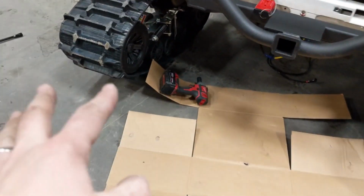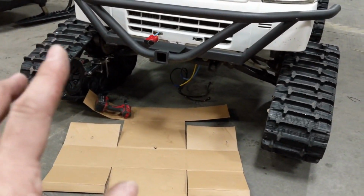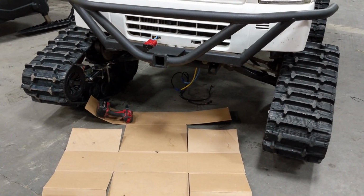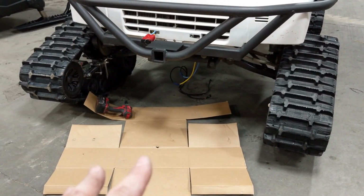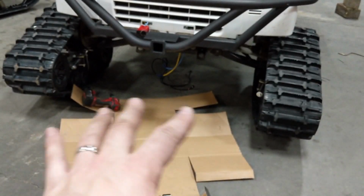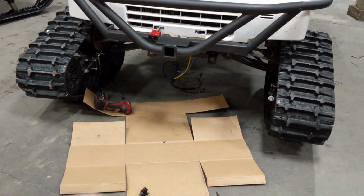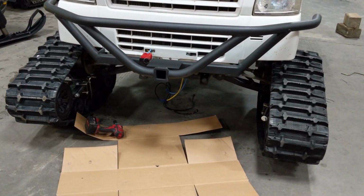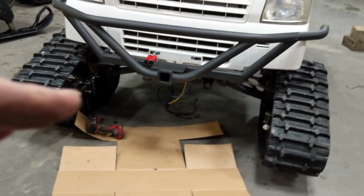And before you do your wheel alignment, once you drop this truck off the jacks, don't do your wheel alignment on the jacks, for one. You'll get it wrong for sure. And don't do it once you just drop the truck down off the jacks. I always like to drop the truck down, back the truck out, do a little bit of a steer, try to get the front end loaded up a little bit, push on the brakes a few times as I'm pulling the truck back in ahead, nice and neutral steering. I'll back up and do that a few times. That makes sure that suspension settles out.